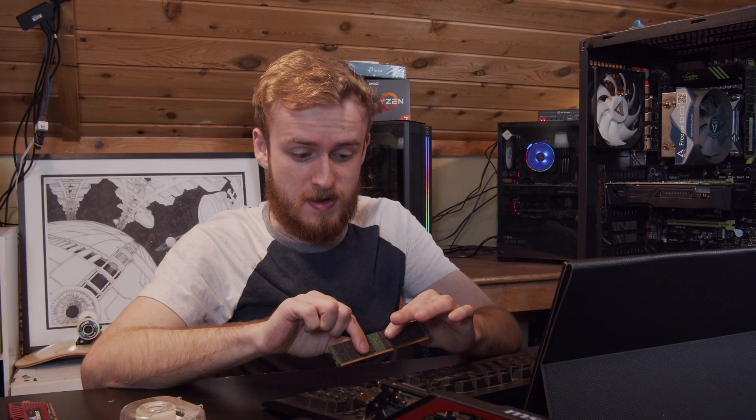Let's put some tape matching it to the important pins here. Sadly, they made the important pins very difficult to access — that's what this little plastic piece is for, to prevent the front pins here from getting messed up. But we're going to purposely do that — mess those front pins up. I don't think this is going to boot now, since we're messing with the important communication lanes. And it looks like... we've got graphics output, even though the front pins are messed up. It looks like we went straight to Windows.